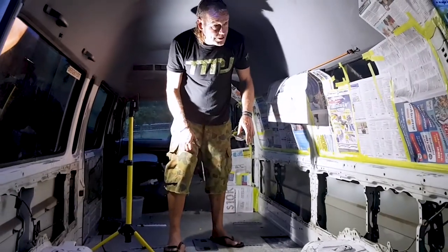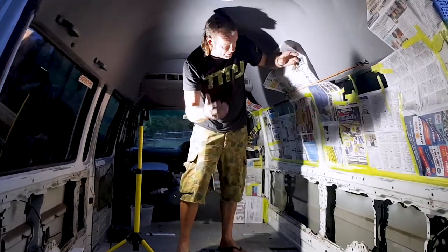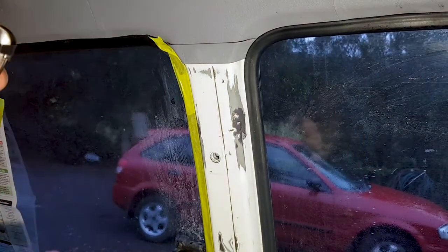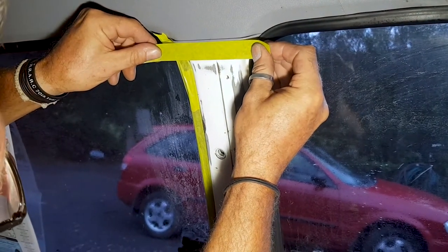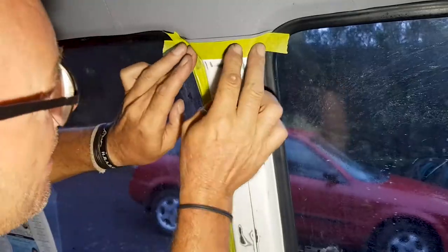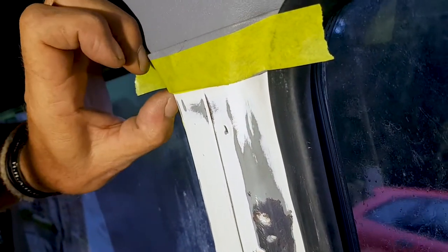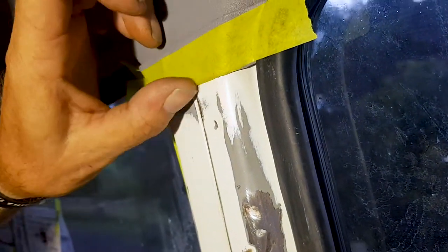Now we're masking up — masking up is just basically sticking newspaper, or whatever sort of paper you've got, over the bits that you don't want to paint. Here's a little masking trick: pull out a bit of masking tape. When you put the masking tape on, don't have it right on the edge — have it a couple of millimetres over the edge. Pull it around, run your fingernail around there, and it folds that bit of overhang to the underside of that plastic trim, so you don't get paint on the underside of that plastic trim.